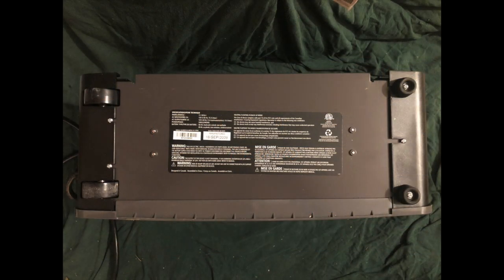The batteries I bought, and the batteries that were in the unit, are sealed lead acid with absorbed glass mat. So you can safely turn the unit over — the batteries will not spill or leak, unless they're defective. So I flipped it over onto the top to loosen the bolts and screws on the bottom, to move the front and rear panels out of the way. I removed the screws and identified all of them, putting them in little envelopes marked where they came from and where they have to go back to.